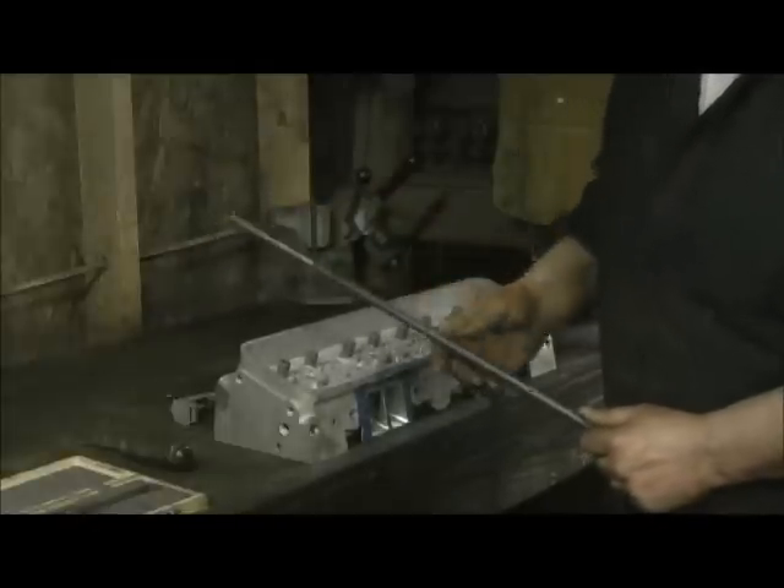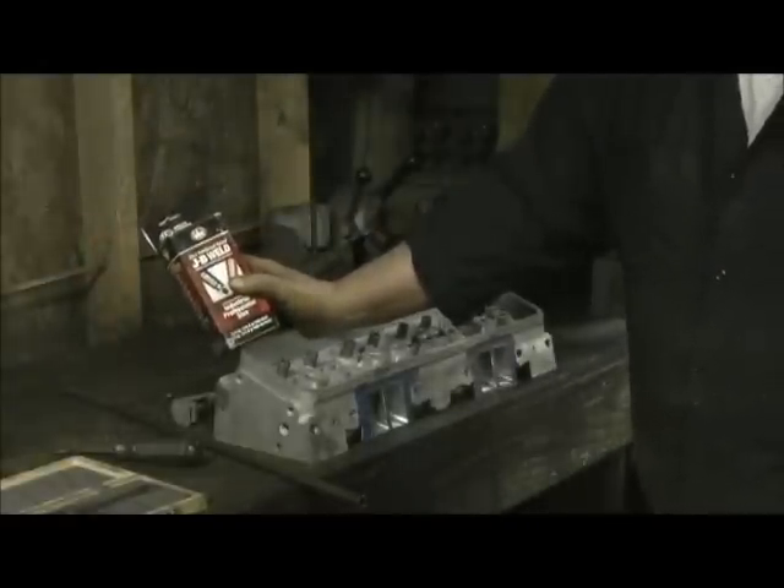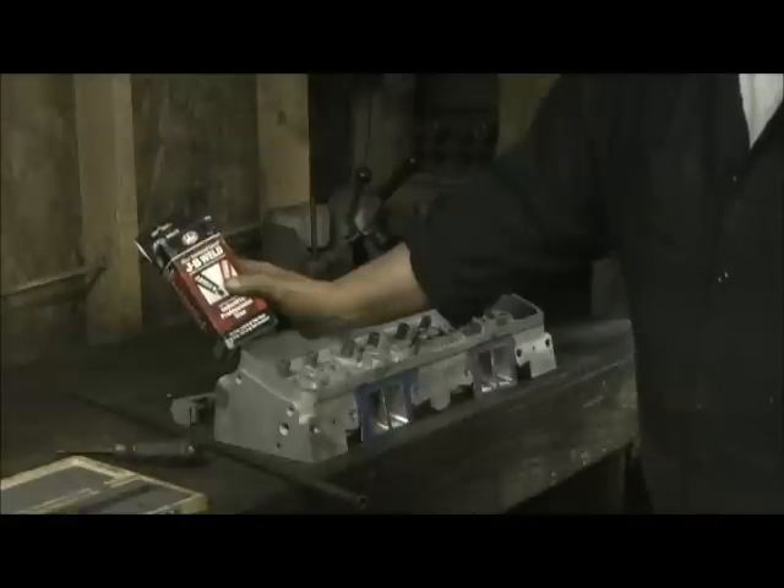First I've got to go over here and wire brush it really good to remove the epoxy. Then I'll make the four marks, two for each head, clip them, and then I'll be able to use JB Weld epoxy. I'll put it on — that'll be the last thing I do this evening — let it sit up for about eight hours, come back out, blend it off, and they'll be good to go.